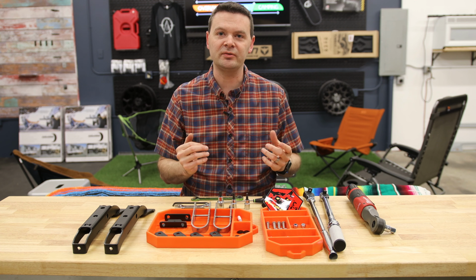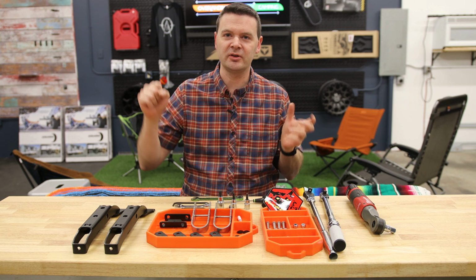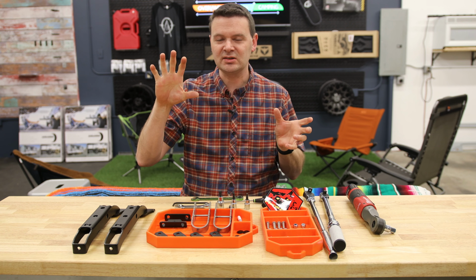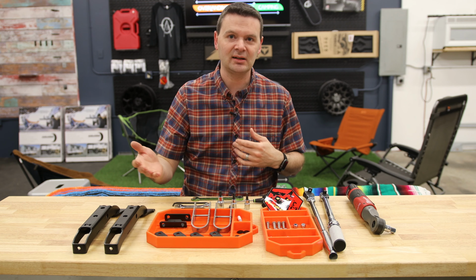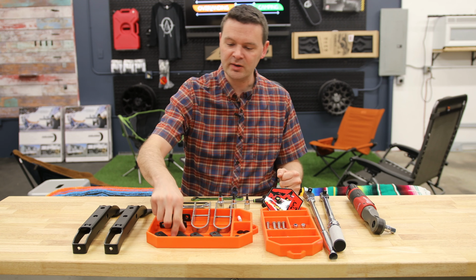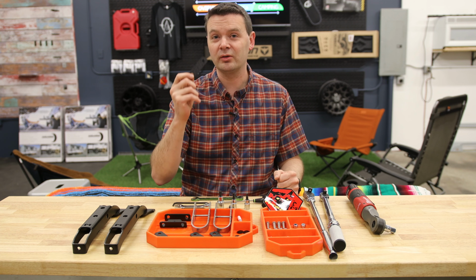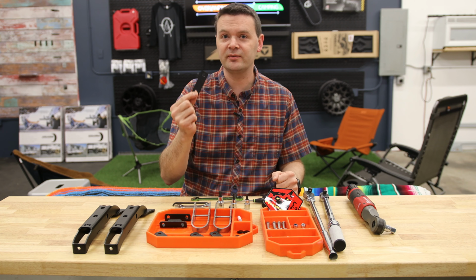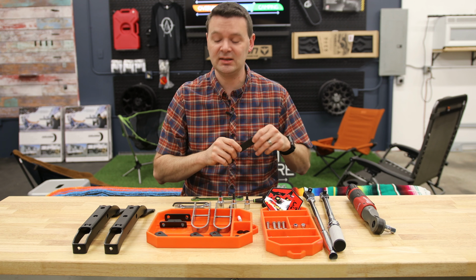On the Kargo Master Safari, when you did the install and you unbolted both of them, there would be a tendency for the door to shift some and get just a little bit off-centered and misaligned so that it didn't shut as cleanly as it used to anymore. You also get these spacers. Now, this is really important that when you order these, that you order the right spacers. It's a separate spacer for the JK and JKUs than there are for the JL, JLU, and the JT Gladiator.